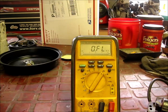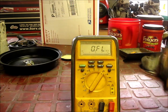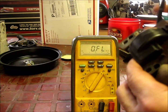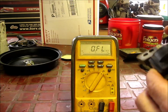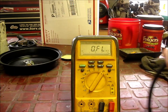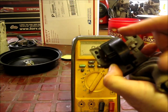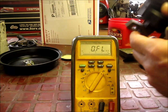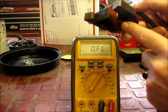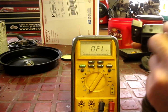Make sure the ground posts it mounts to are clean, and make sure the bolts are oiled and clean — it can make a difference. These coils do burn out; there's electronics inside, and that's where you get your dwell — that's what acts like the points. This one says 'this side out,' which is the cylinder side. Usually when you mount them, the tang for the ground is underneath.